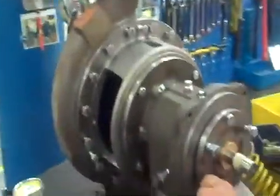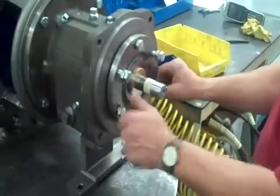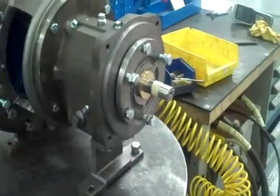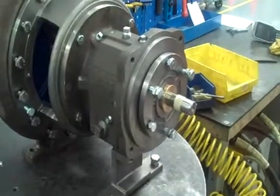The first thing you want to do is loosen these back bolts here — this is where you adjust the impeller. If you don't have enough room to bring that case up to the impeller, you could damage the impeller. So keep them nice and loose before you tighten the case bolts.